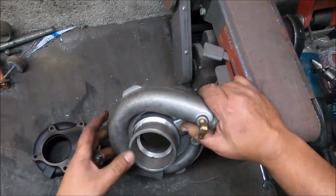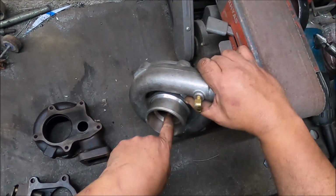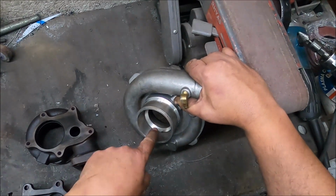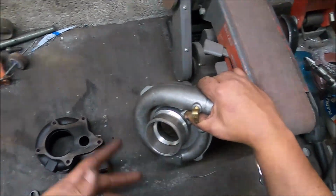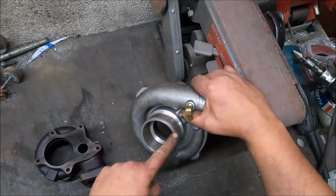And what I might do, but I don't think it's massive gains, but if I can do it quickly I will, is the compressor inducer sits a few mil down there. So potentially I can smooth this, so rather than being such a sharp angle, it's a bit shallower, which again would improve flow. But that is very minor because it's not like it's hitting a wall like this.